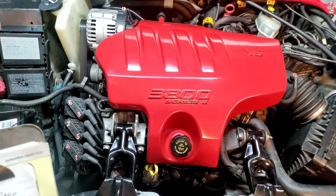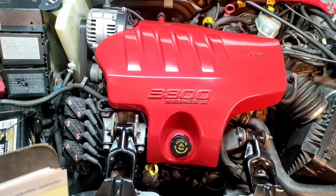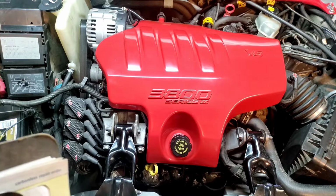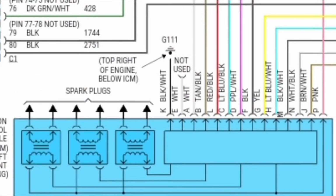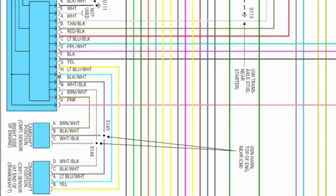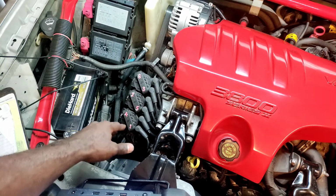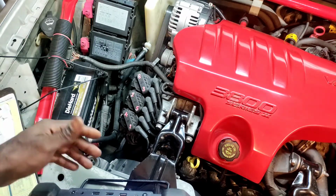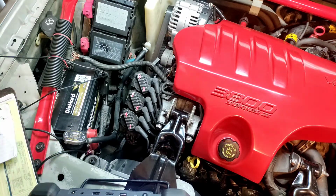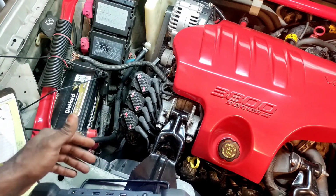So just to address some of the things that were in the previous comment section, which was, most of my mass following, 2 comments. One person mentioned, let's see here, if it was the CAN gateway. The ICM, ignition control module, has no CAN gateway. And I think there was probably some miscommunication, as if I did bring up CAN gateway, it was just out of conjecture and speculation before I started really looking into it. I do apologize for that. But this doesn't have a CAN gateway.